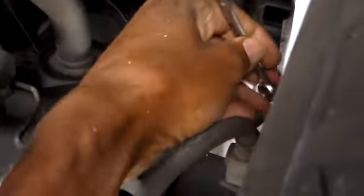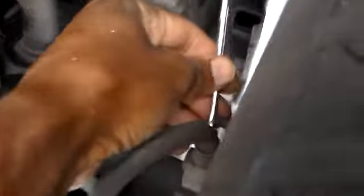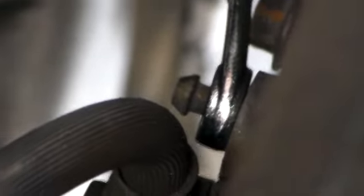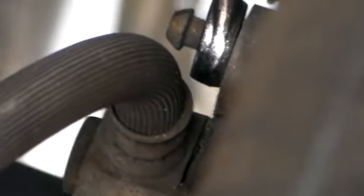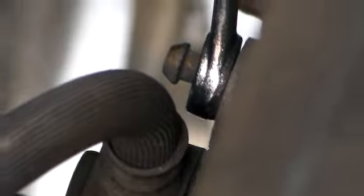Got to get the right tool to fit around the nut - this is a 3/8. I'm going to make sure it fits around the nut here. It fits - close-up. My next step is to make sure that fits, so I'm going to push forward to open it up to release the brake fluid. But before I do that, I'm going to put my hose on from this self-pumping tool. Stand by, we're going to do that next.